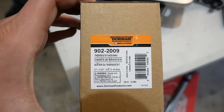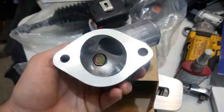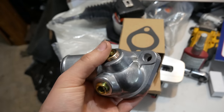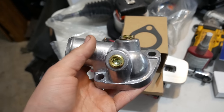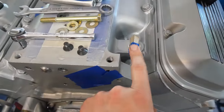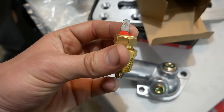Of course, it'll need a hose to do so, but we'll take care of that after we figure out the thermostat housing. This one was inexpensive, easy to get my hands on, should be facing the right direction, and has threaded ports, one of which we're going to need. The intake manifold is only set up with one threaded port into the coolant passage, which we're already using for our coolant bypass, so we'll need another for this temperature switch.